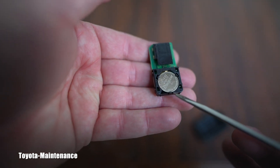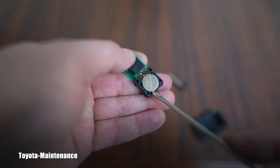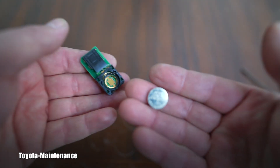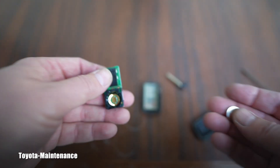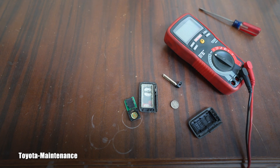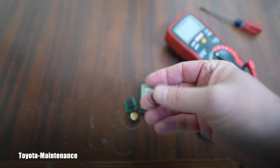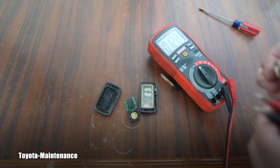The smallest tab is here, and two, and three. To get it out the easiest way without damaging anything, the best is to pry from here. If you look at the orientation and location of my screwdriver, it's right here, and it very easily pops out. This is the depleted battery as Toyota would say. We need to bring a new one. Now, we are all mechanical geeks, Toyota geeks — do you think we will just throw away the battery without finding out what the voltage is? So multimeter on volts and let's see what made it fail.